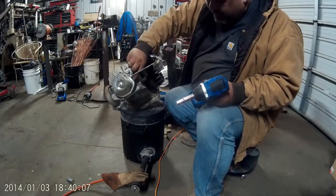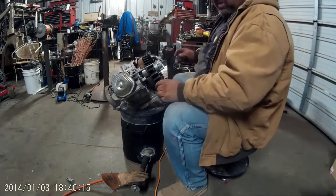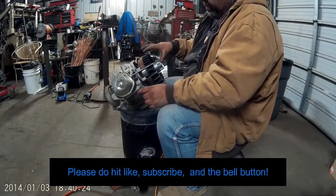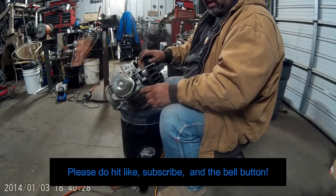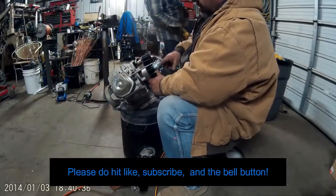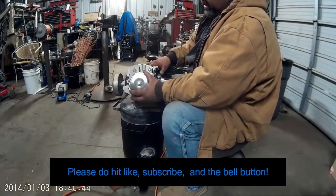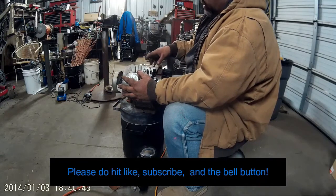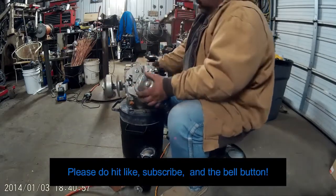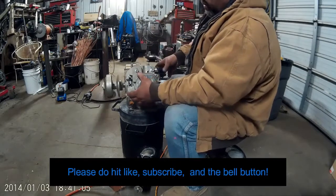I'm not sponsored by anyone — this is not a sponsored channel, at least not at the moment. Feel free to sponsor me, feel free to hit the like, subscribe, and bell button. This is going to be for an off-road cart, so we're not going to be zinging 5,500-plus RPMs on a regular basis. We're probably going to leave the stock flywheel on it, put a second charge coil pack underneath, and we are going to put a billet rod inside and 50-pound valve springs. The governor delete and oil sensor delete have already been done.